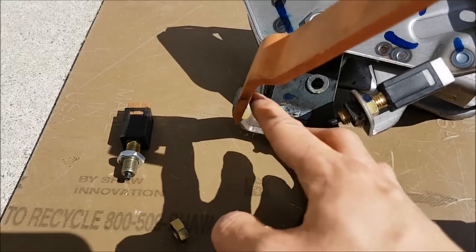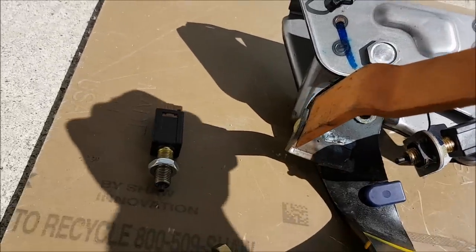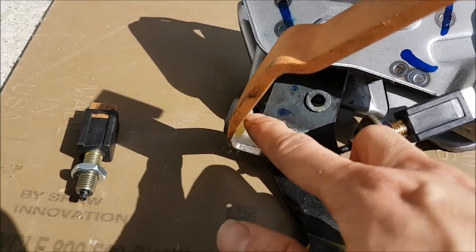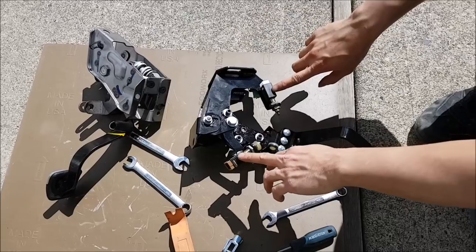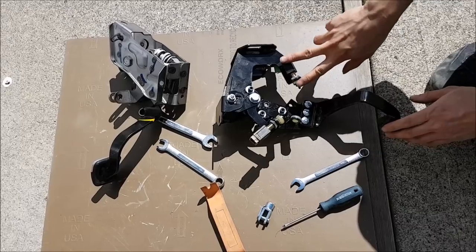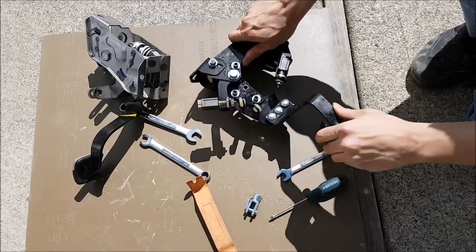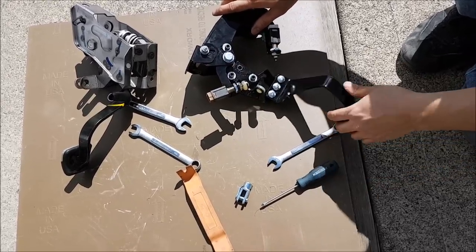What we've done now is move over the rubber bumpers and make sure we put the switches in the correct locations — this is the one that was on the cruise control, and this one goes all the way over to the starter. This is adjustable, so don't worry about it; you'll tighten it down afterwards. We just have to double-check that we are engaging the switches properly and not at a weird angle. Then we just have to transfer over the pedal cover and we can reinstall this into the car.